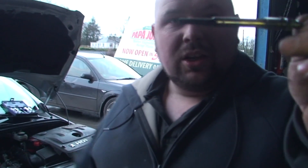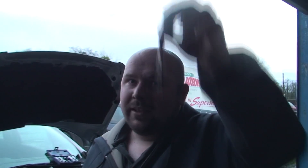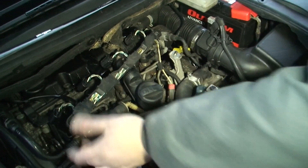This woman was complaining about the car being hard to start and thought it was a heater plug. This is number two heater plug and as you can see, look at all that oil — just absolutely caked in oil. Now there's not necessarily a problem with the plugs themselves; what could be the problem is the valve seals could be gone. If the valve seals are gone, that's why it's pumping oil in, and that's why it's hard to start especially in the morning. You'll know if your valve seals are gone because when you change gear you'll see a puff of blue smoke out the back, and you'll also be losing oil. It's always best to change the heater plugs first because it's the cheapest and easiest thing to do, but if you see oil like this there's a chance you've got another problem.